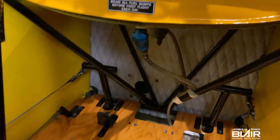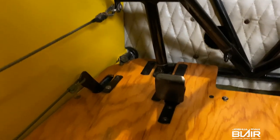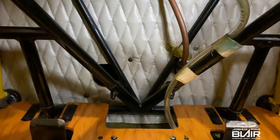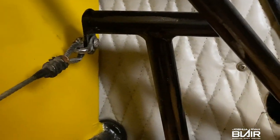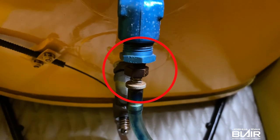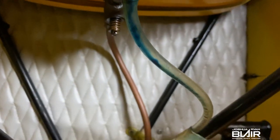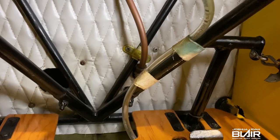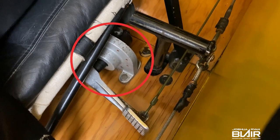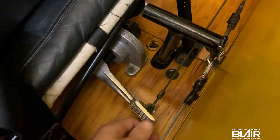Moving down to the front floorboards — here's a close-up look at the rudder pedals and foot brakes. The brakes are down here, one for each wheel, and the rudders are up there. You can see the bottom of the fuel tank here — this is where I sump. This is the sump drain, and I'll catch the fuel during pre-flight outside in the fuel catcher. Getting back here is the Scott brake operator, which I recently added brake fluid to in one of the videos. You use that with your heel, connected via wire to the front pedal.